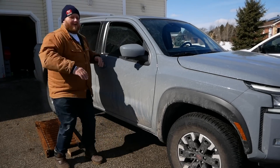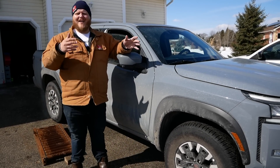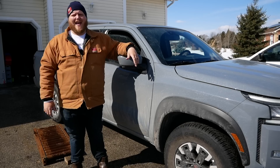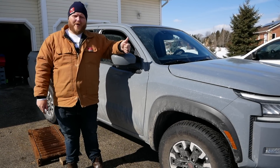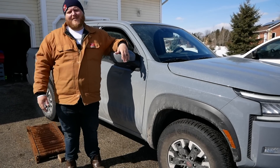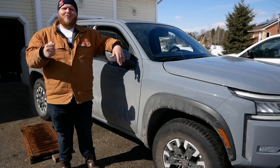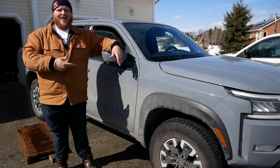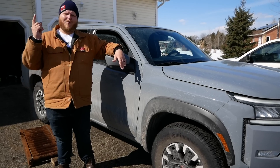We have arrived at the end of this one. We just got these rollers and we're going to keep refining this process to keep bringing these tests to you. So what's the big takeaway on all-wheel drive versus four-wheel drive? All-wheel drive these days is better than ever, and in my opinion it's about 80% of a four-wheel drive system. But if you want a system that is locked in with the settings that you put into it, you're just not going to get that out of all-wheel drive — you've got to go four-wheel drive. Is there a better system? No, it just depends on what works for you.